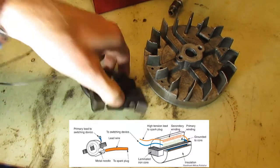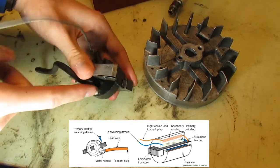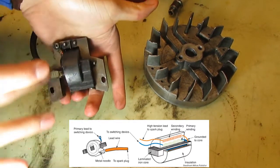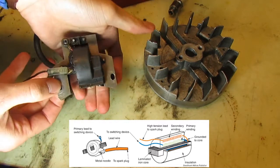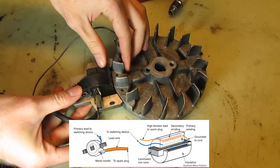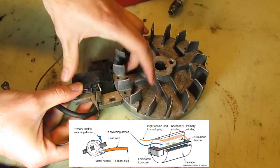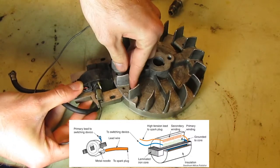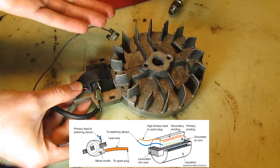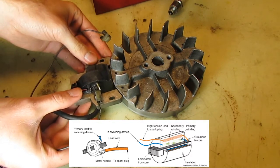You can't see inside this magneto, so I'll try to put up an image of the coils. Basically the coils are in here in this black portion. This metal horseshoe shape is also there to help create the electromagnetic field. It sits up against the flywheel but has to sit a certain distance away. If it's too close, there's a lot of friction and it doesn't create the right electromagnetic field — it doesn't create enough electricity. The same thing applies if it's too far away, so we want to make sure it's right within a nice little range.